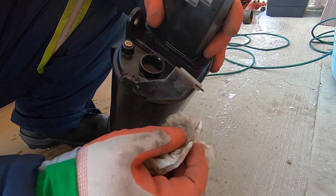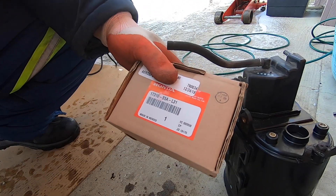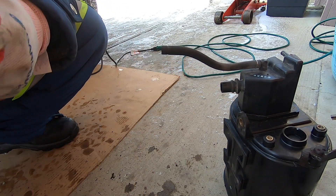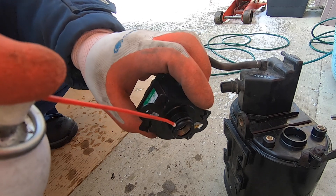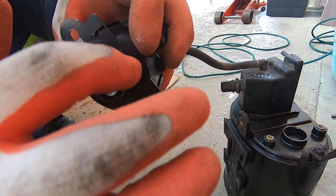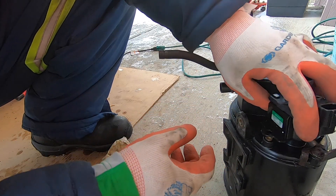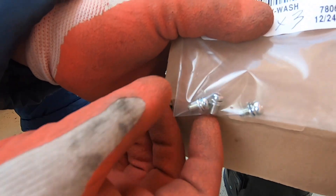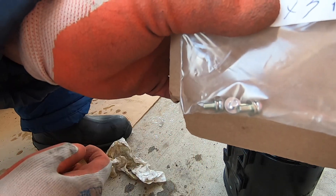Clean up the area as best you can. The new part is a Honda 17310-S5A-L31. Add a tiny bit of oil onto the o-ring and rub that on there, then wipe off the excess. Slide the new solenoid on, then install the new screws from the dealership — I ordered three but we'll just put two in. Before that, put some anti-seize on them so future removal is much easier.